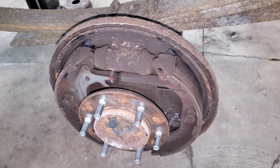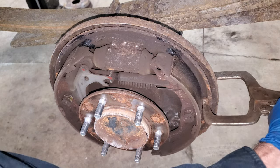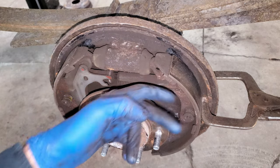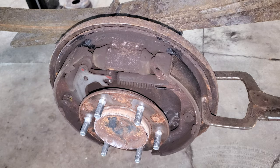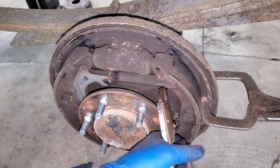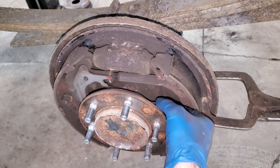First thing I'm going to do is put a clamp on the side. I like to do that because when I take this spring off it's going to push the wheel cylinder over this way, and sometimes on some vehicles it'll pop this side of the wheel cylinder right out and brake fluid will go all over the place. I put this on as a safety precaution. Then I can get in here with a vice grip and take this spring off, just prying up against the hub.